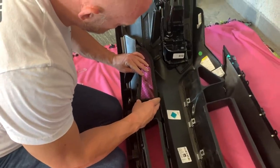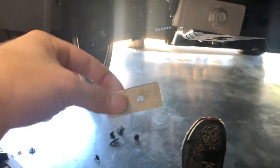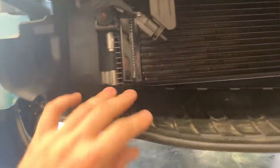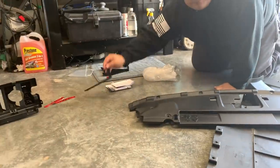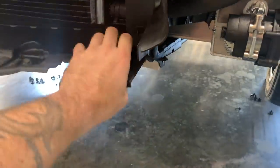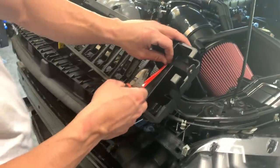Stick it on there and put it through the screw holes. Down at the bottom you have these clips that you push in toward the outside of the bracket area. Take these guys right here — make sure that ledge goes toward the back of the car — take your supplied push pin and put it through the side there and that will support it. If you have a non-performance pack car it comes with some other pieces, so adhere to the instructions. Once that's done it'll be solid as can be. There's a 10mm under there and now the crash bar — it doesn't have any clips, so you're just going to 3M this thing back on.